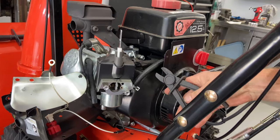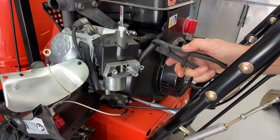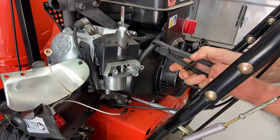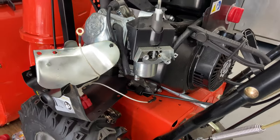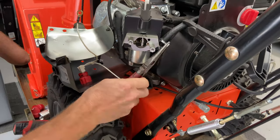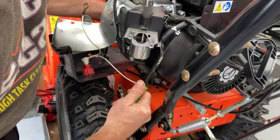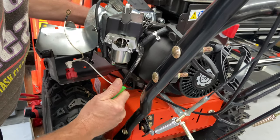So I'm going to use the fuel line shutoff clamp and just pinch it — this is just for extra protection to make sure nothing comes out of there. And then we're going to go ahead and move the clip off the fuel line. This tool is very nice to push the fuel line off without hurting the line.